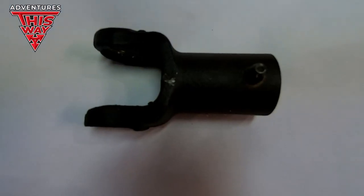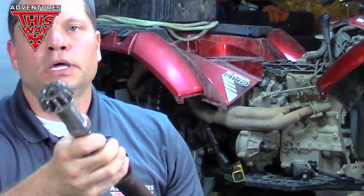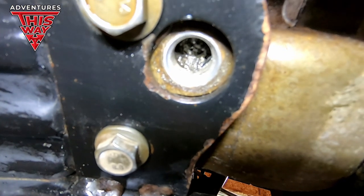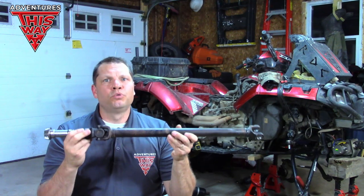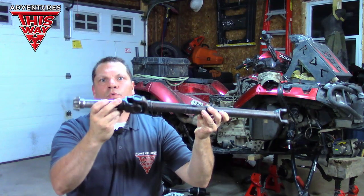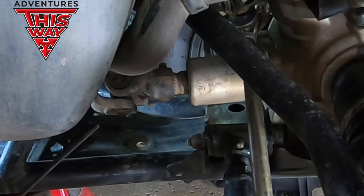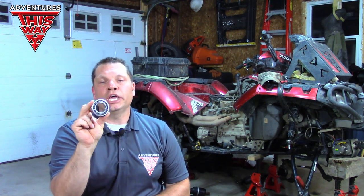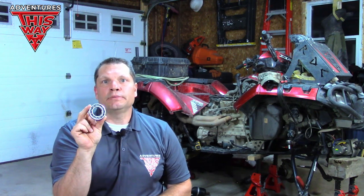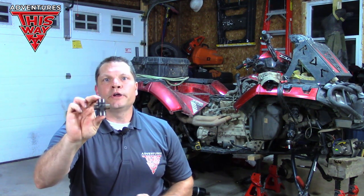There's actually a grease fitting on the back U-joint that you're supposed to grease regularly as well. What can happen — and what happened to me — is these U-joints got worn out. I may have pushed it a little too hard and I didn't inspect them. When they get wobbly, that wobble wears out your pinion bearing, and bang — you've got damage to your front differential. You want to avoid that at all costs. This bearing is an easy maintenance item to change; even if you can't do it yourself, a shop can do it for minimal cost compared to more differential damage.